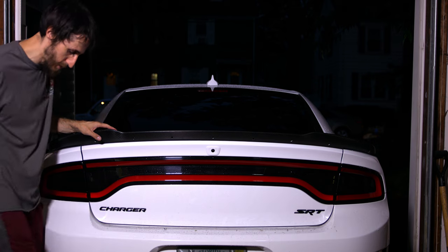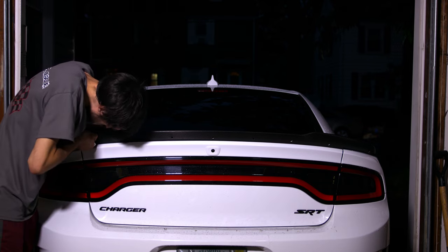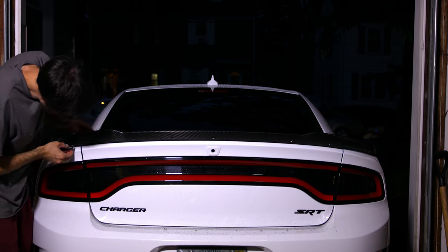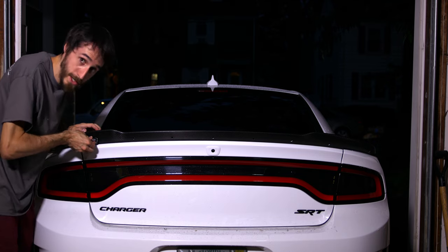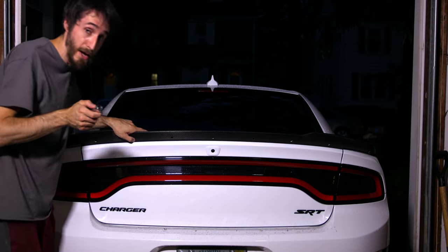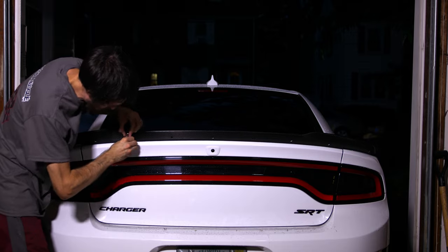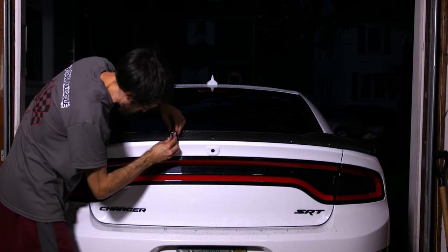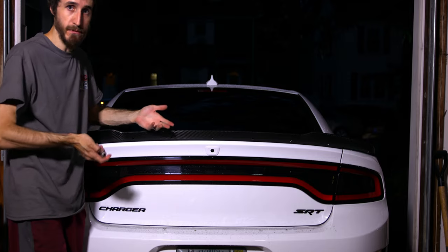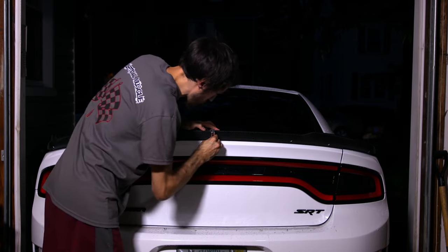I'm going to use a socket — not a screwdriver. It's shorter, round, and smooth so you're not going to scratch anything. You're just going to roll the socket over top of the hole to make sure it's perfectly flat, because sometimes you'll pull back some plastic and it won't be flat, then the rivnut will be crooked and your screw will have to go in crooked, which could crack something. Roll the socket over the vinyl and the spoiler — this way the rivnuts are going to lay directly flat. If a screw goes in crooked, your washers won't sit flat and your car is not going to look good.